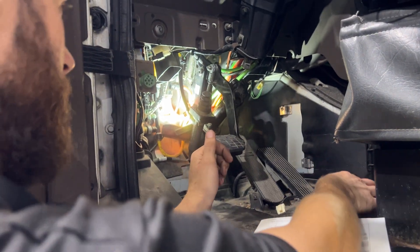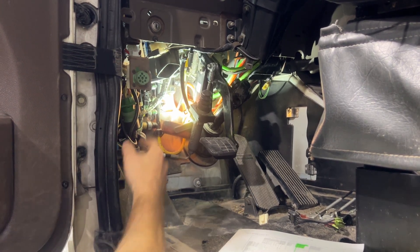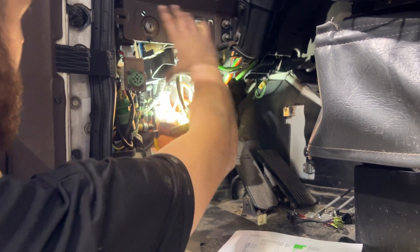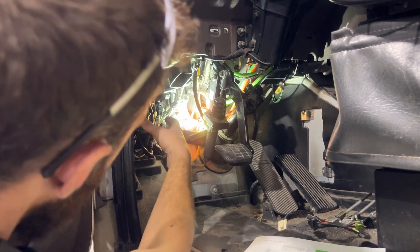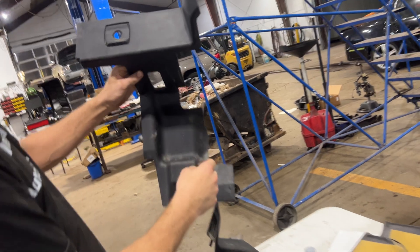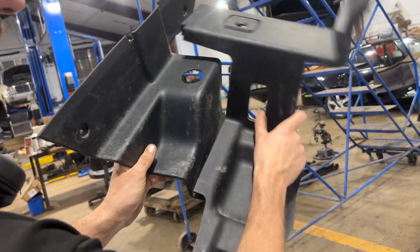In order to get to this thing, you have to remove a bunch of covers. Take the floor mat out of the way, then remove the side panel trim piece up here. A bunch of the panels overlap each other, so this one comes off, and then you've got a piece that goes across here that covers the diagnostic port and your ignition, but that overlaps the outer one. This one's got your ignition, and the other one with the data link port is this one — there are two clips and they snap together like that.